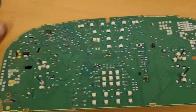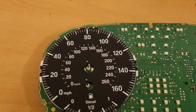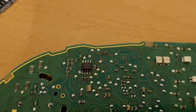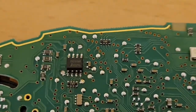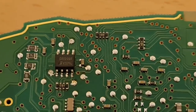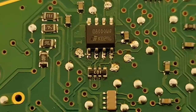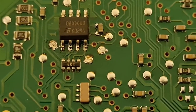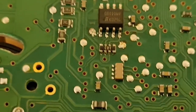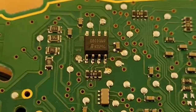So for example, that's your speedo side. What we are interested in is that little EEPROM there — an 08L DQ. We're going to pop it off the board and read it out. There are some dirty soldering marks there — something's been going on. I'll clean them up as well while I'm at it.